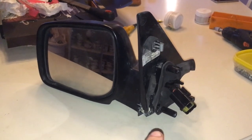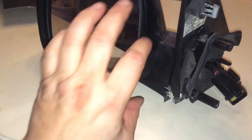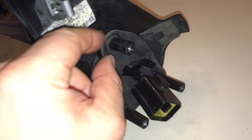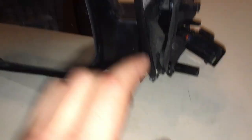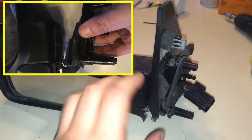So here's my repaired mirror. What I ended up doing was taking off the cover — the foam cover — and removing three screws behind here so that the whole bracket separates from the plastic. When the mirror broke, it broke off on the cast metal in here. It's hard to see because I've used some epoxy to try and reinforce it, but this whole cast metal swivel mechanism for the mirror broke off.